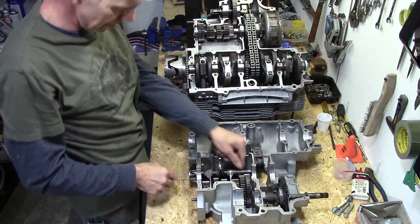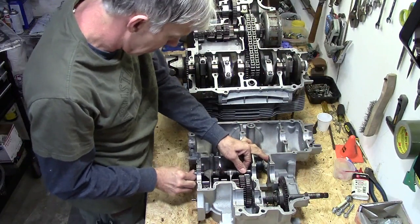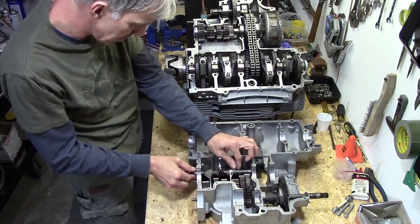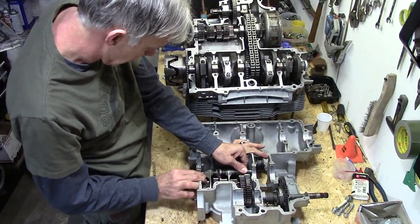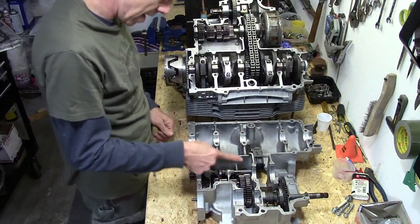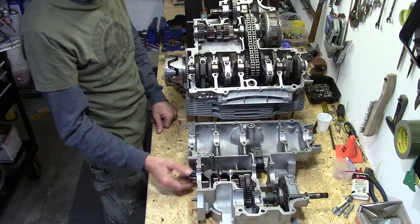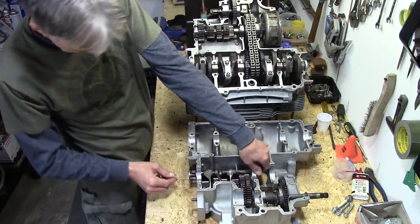Now we need to do a little inspection here. I've noticed that this rod that the shift forks ride on has popped out of place internally. We need to take care of that — that's not a good thing. It's a little weird — it's not wanting to drop back into place just right, but there we go. Push that in and make sure that's all lined up okay, because that would really suck to try to put that back in from the outside when you can't really get in there to align it. It's held in from out here when the whole assembly goes on for the shift barrel and all the shifting mechanism.